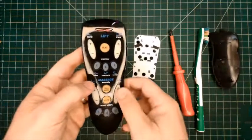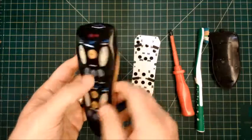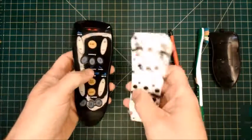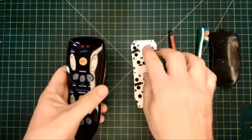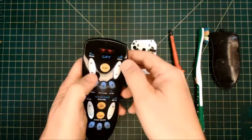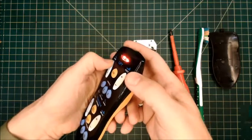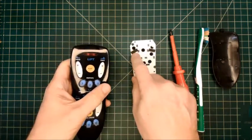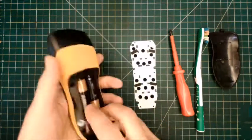They have a lot of problems with the buttons and oil buildup inside. This keypad will replace the electric parts, the conductive parts of the keypad. This remote also has problems with these buttons sticking. The rubber is losing its spring and the button is sticking down. This kit has little foam pads to give it a little bit of extra oomph to make sure the button comes back.